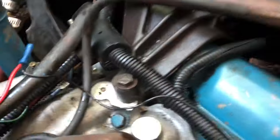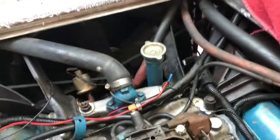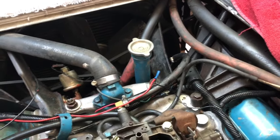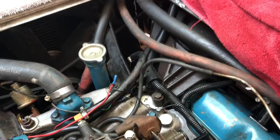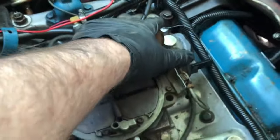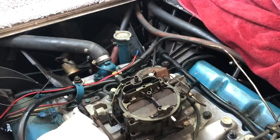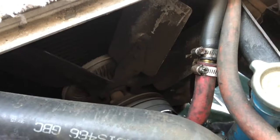Another reason this is a logical first step: we see evidence of oil around there. If we're leaking from our timing chain cover or main seal, this would have to come off anyway. So I'm very excited to get rid of this AC compressor and bracket, which was the bane of my existence when putting this manifold on — I had to grind it down, drill and tap that bracket. We've got our AC compressor out of there, and fortunately it's the forward-most belt so we didn't have to loosen any other belts.